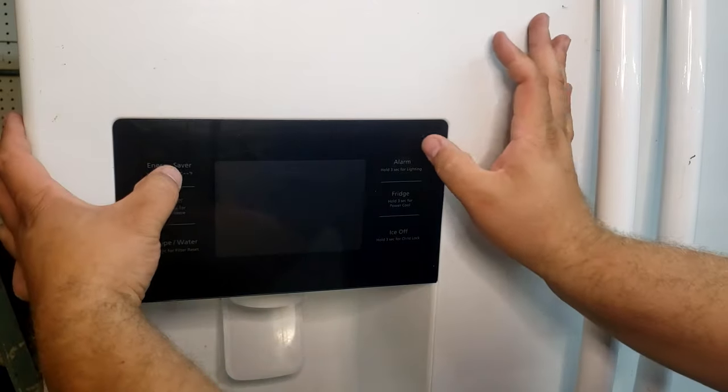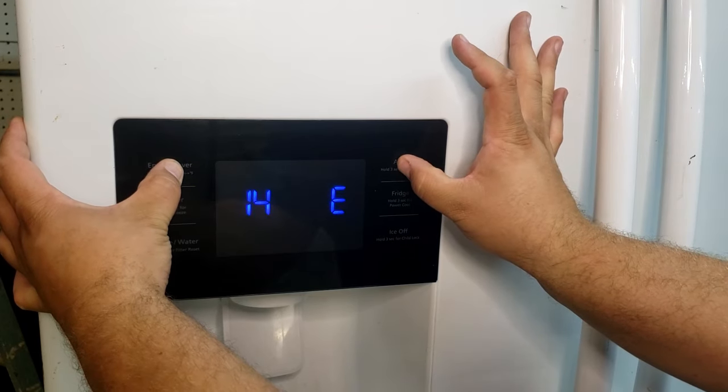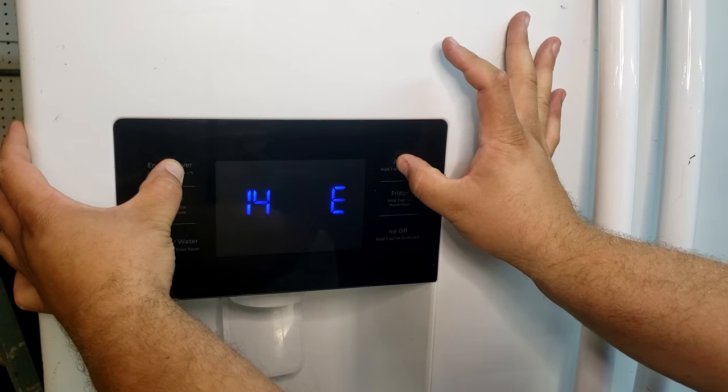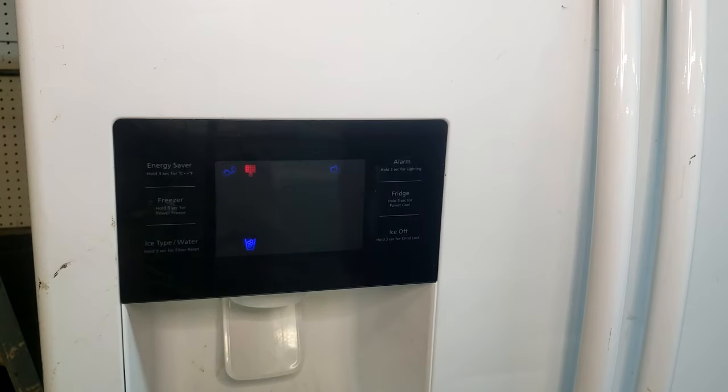To fix this, we need to press the top left and top right buttons simultaneously and then hold them for approximately 8 seconds. The code will continue to display until the machine is put into diagnostic mode. You'll know it goes into diagnostic mode because you will hear a beep. The unit will run the internal processes, then about 30 seconds later it will restore full functionality so you can press buttons again, unless there is a much greater issue with your machine.